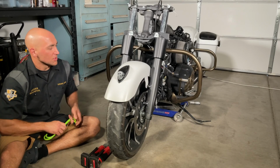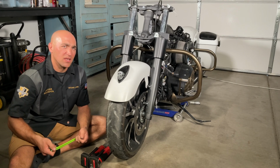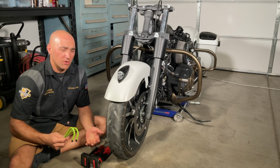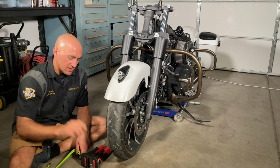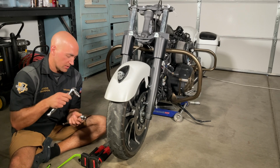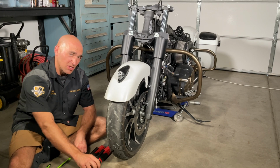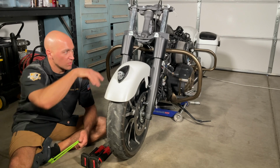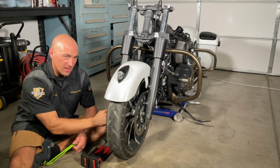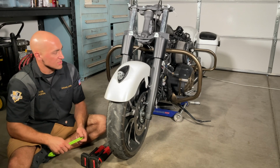I'm not going to go into super depth detail on this because in our 2155 wheel test fit and install video, we showed you all of what it took to remove the fender and the wheel with the brakes. But just a quick recap, you're going to need a 1/4, 3/8, and 1/2 inch drive, ratchets or wrenches, or we got the electric ratchets, sorry. And then from there, you're going to need a 6, 8, and 14mm Allen socket because that's what we need to remove these. Quick recap, 6mm is to remove the fender with the 2 locking nuts here on the axle. The 8mm, there's 2 on each caliper mounting bracket, and the 14 is the axle itself.